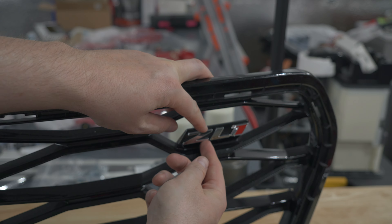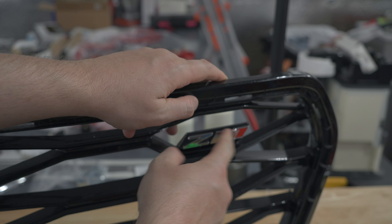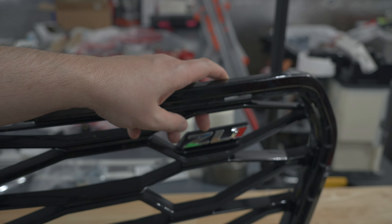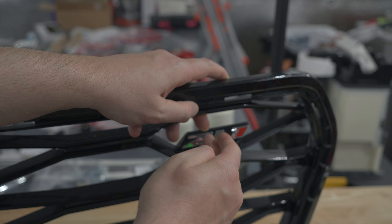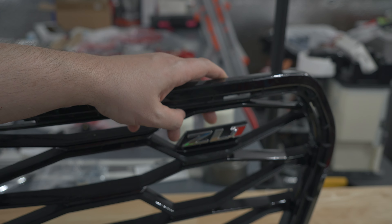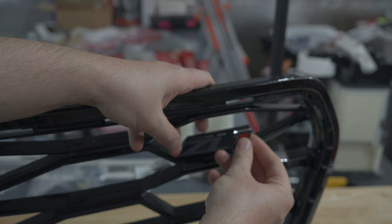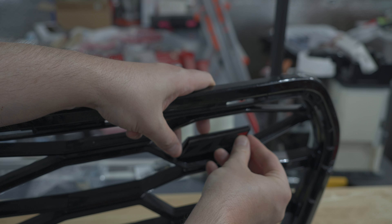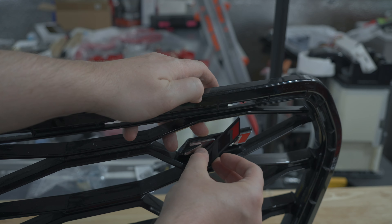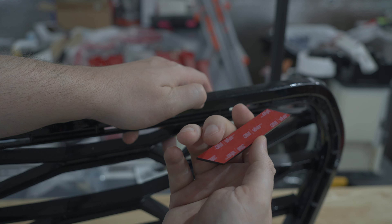What we're going to need to do is get a heat gun. You're going to want to heat up the emblem — just make sure you don't get too close or too hot and actually melt or warp anything. You want to get it nice and warm so the adhesive comes a little bit undone. Then you can use something like dental floss, work it behind your letters, and peel them off. Once you pop your letters off, clean it up with some Goo Gone to get a nice clean surface.